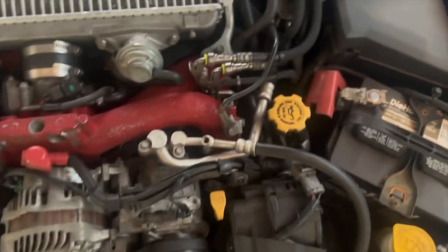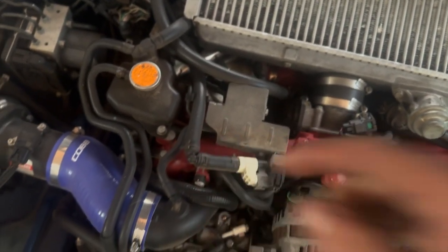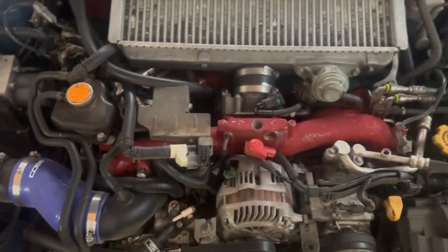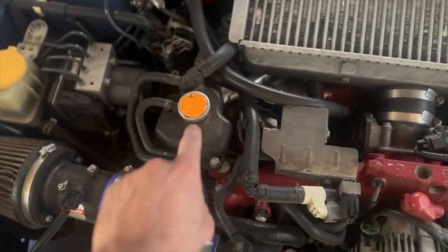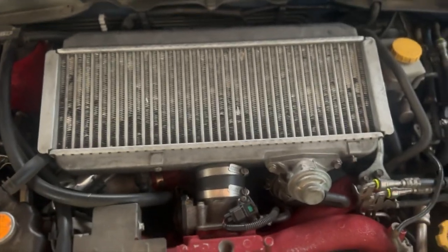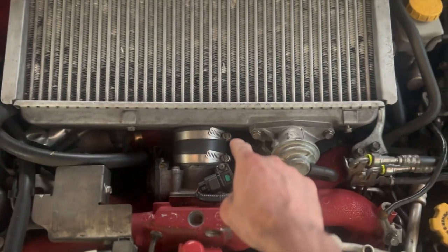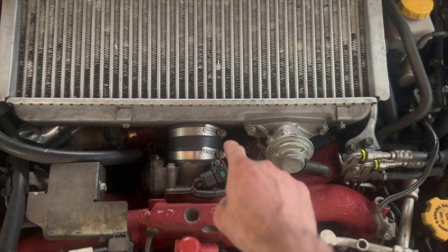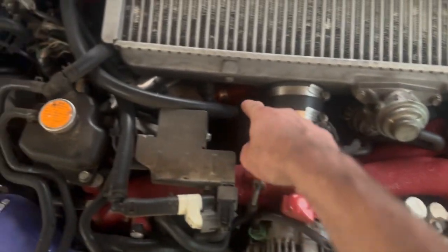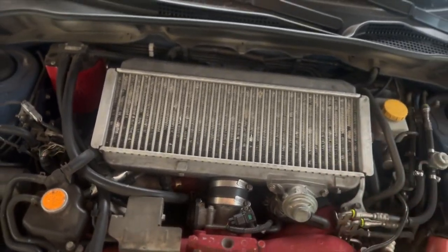You start with four bolts on that side and four bolts on this side of the intake — all 12s — so you want to take those off. To get to these ones you have to take this cooler off, which has two 12s here. Then take the intercooler off, which has one 12 here, a flat head right there, two 12s here, one flat head down there, and usually one 12 there but this one doesn't. Once those are all off, take the intercooler off.